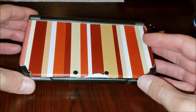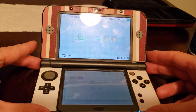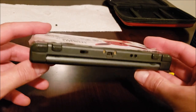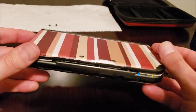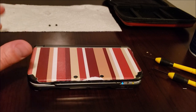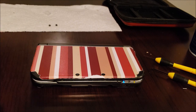I think we're good to go — let's test this out. Let's check the left trigger and the right. All seems to be well; we are back in business with the new Nintendo 3DS XL. This is one situation of diagnosing and repairing an issue with the shift triggers. The method using the aluminum can to raise the height of the button may seem a little shifty, but given the situation and the time, it did solve the issue, and unless this thing is dropped again in a similar fashion, I expect the repair to last for a long time.